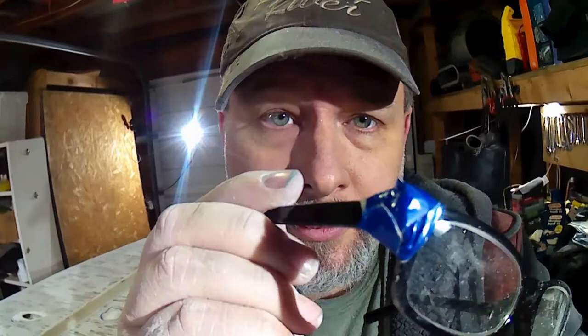So if you take anything away from this video, anything at all, duct tape, even blue duct tape, very handy to have around. Here's where we are. It's 7:45. It's 30 degrees outside. I got these heaters cooking, and they're keeping it nice and warm and toasty inside the garage. We got all the decay cut out of the boat, and all the other imperfections and scratches and gouges. Just a light patch with some resin and some mat will fix those up nice and easy.